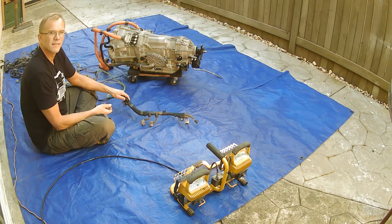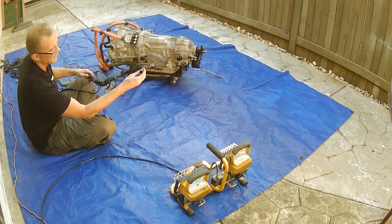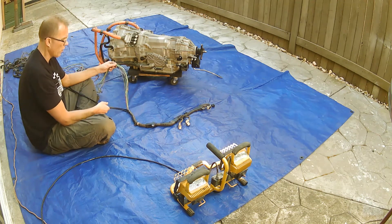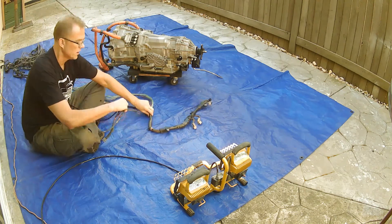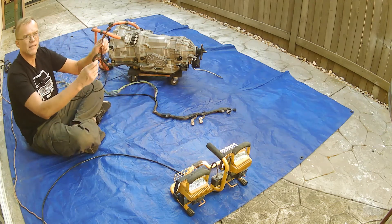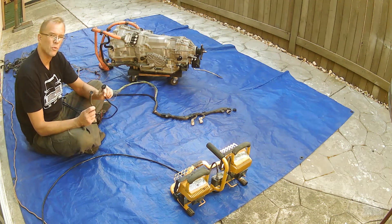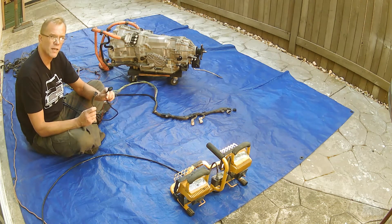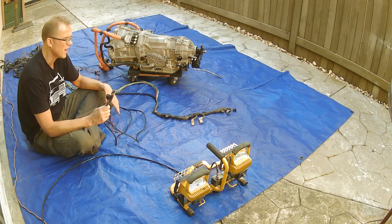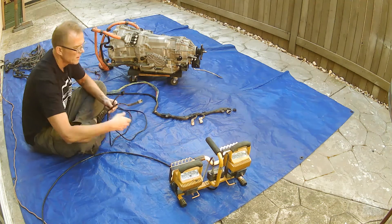The reason I bought this harness is that although you can buy plugs and automotive-grade wire and make parts of the harness yourself, what is very difficult are these shielded twisted pair black cables — the resolver cables. When I thinned out the harness I realized there are matching plugs on the other ends that plug directly into the primary wiring harness, which has the inverter plug. This alone is worth $250. I've heard talented electricians who built these harnesses from scratch say they would never do it again — too much room for error.